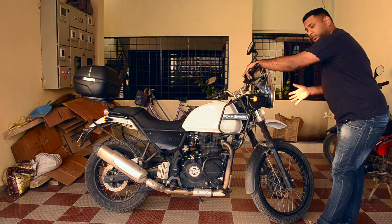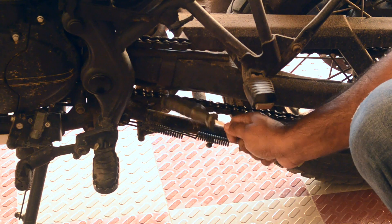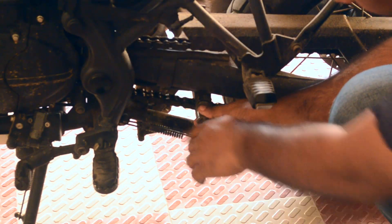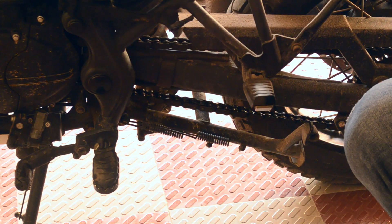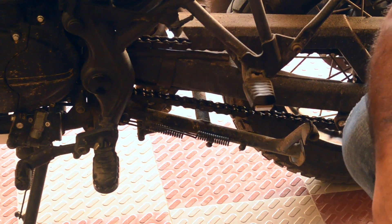The next thing is D for Drive. Most of you will have chains; some, like Harley-Davidson owners, may have a belt. Use a screw of about one and a half inches as a reference and place it against the chain to check the slack — the gap should not be less than or more than that measurement. If the chain is too loose, head to a service center or local garage to get it fixed. Also check that the chain is well greased with the right amount of lubricant.